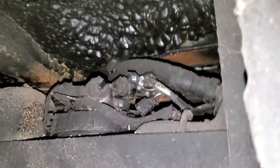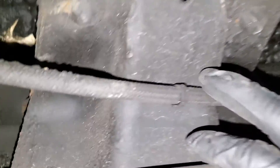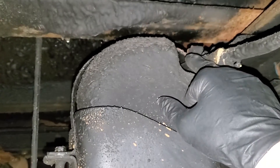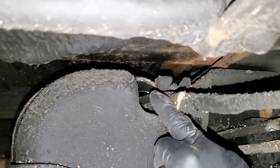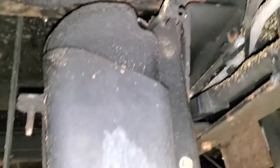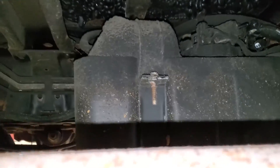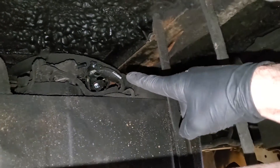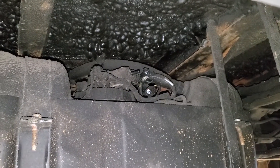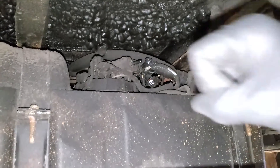The conclusion for this repair is obviously replacing the DEF pressure line. I don't think I need to give a full rundown of how to replace it — it's pretty self-explanatory. There are locating tabs holding the line to the body in various spots. I'd recommend taking this bracket loose — just pop it out, no big deal — and there's another alignment tab further down. Before you leave, hit the like button, subscribe, and let me know in the comments if you've had a P20BD for your DEF line heater resistance. Thanks for watching — see you next Friday!